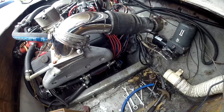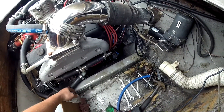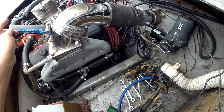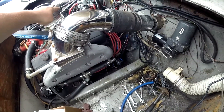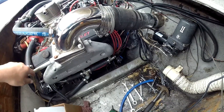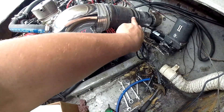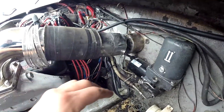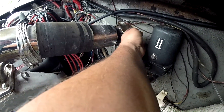Here's a good shot of the whole wet exhaust system. The exhaust manifold has engine coolant going through it to cool the exhaust coming out, and then seawater goes through a pump to further cool the exhaust. I have a chiller on the other side, so it uses seawater to cool the engine coolant, meaning antifreeze goes through the engine instead of raw seawater. The part I'm working on is this coupling here — I just slide it forward, but I've got to clean these up first.